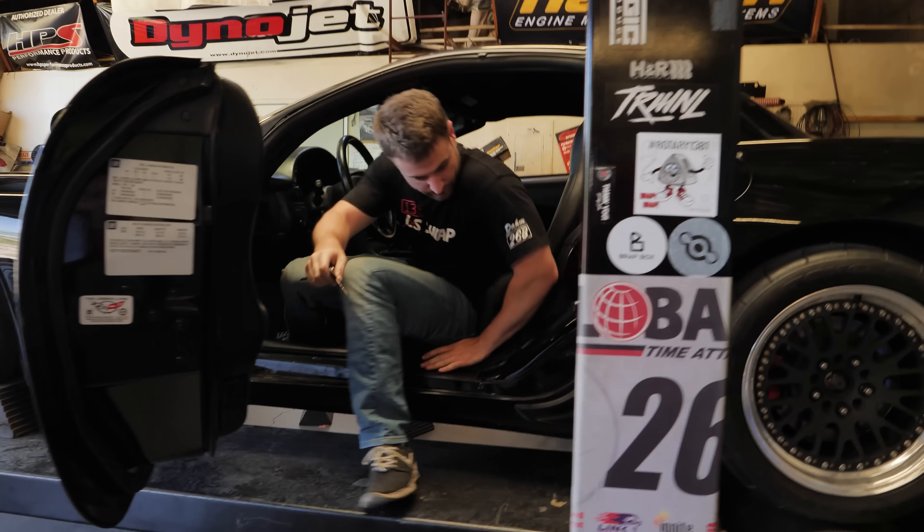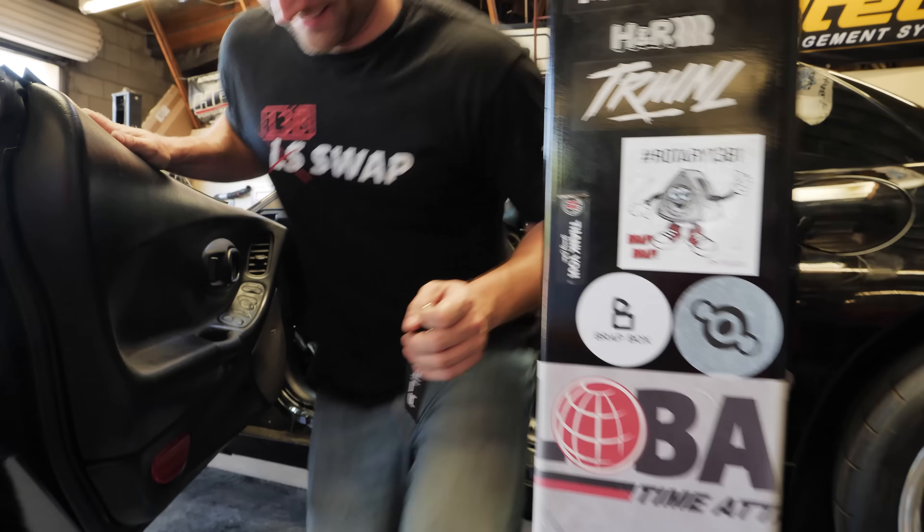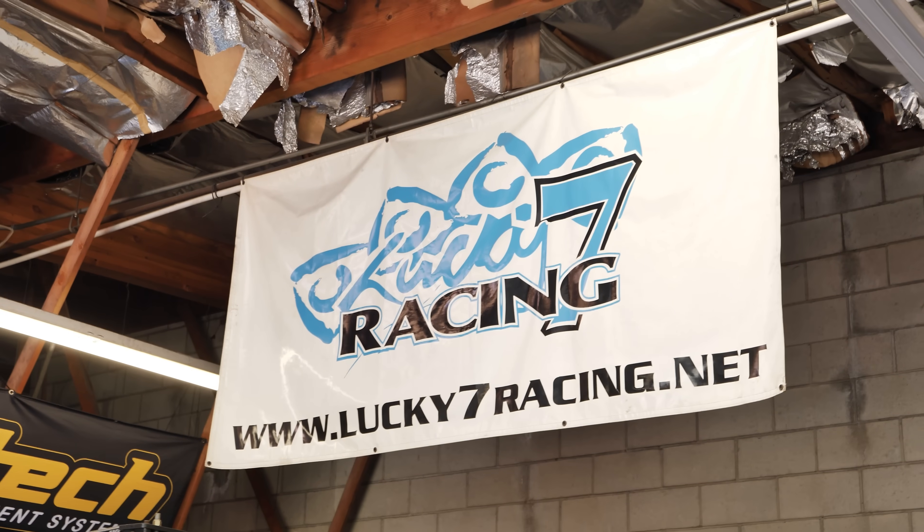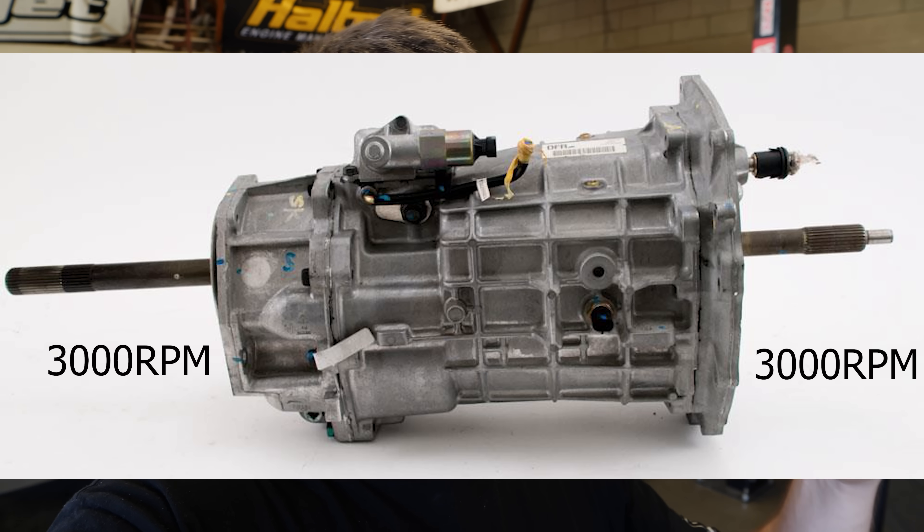This dyno is made for FDs, so I don't see why the door would be a problem. This is just an American FD. Fourth gear on this being one-to-one means the speed going into the transmission is the same speed coming out, so we're going to hold it at 3,000 RPM and make sure the dyno synchronizes to the car so we know our correct RPM range as the dyno chart goes. You can also do it with spark pulse, but from the dyno it's pretty accurate when you know your gearing 100%.